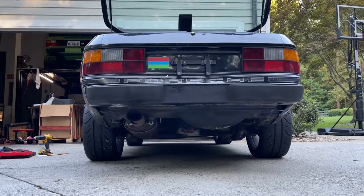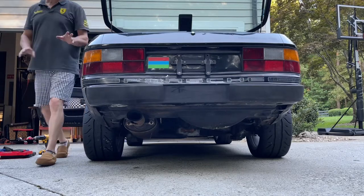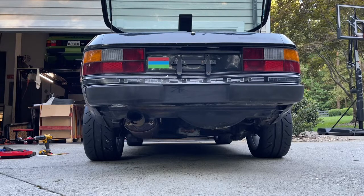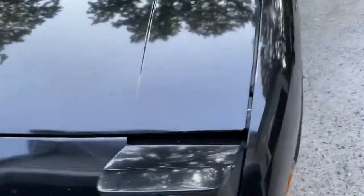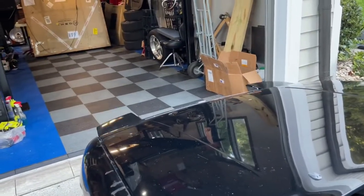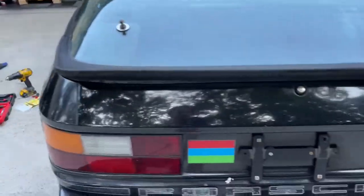Let's see if we got brake lights. We changed out the brake light switch. We've got no lights coming on now, so I'll have to mess with that a little bit. We've got turn signals going, and then no turn signals — so I don't trust that stalk. We'll put the pop-up headlights down and close the back. You can hear it's missing a little bit — it's hunting, lagging, and leading, and doing all kinds of stuff.